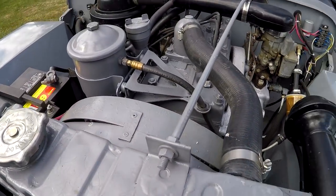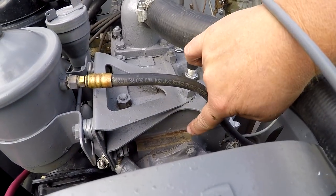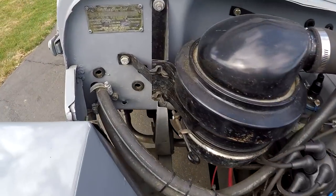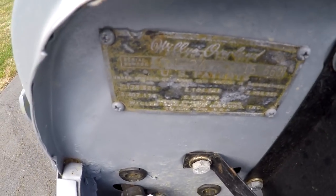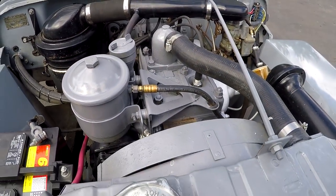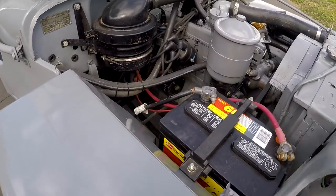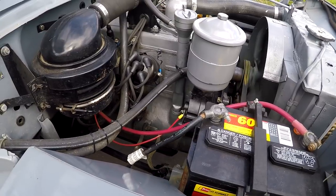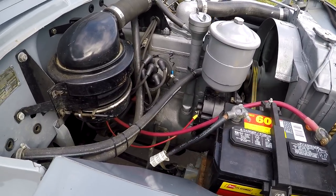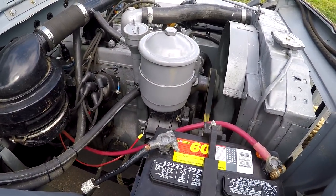The ID number on it is 12234160 right here - that's what it's titled off. The engine number is there, and you can see it's got a Willys tag - number 152660. The title is titled off the engine, which isn't uncommon on a lot of 30s and 40s cars - this is a '48. If this was an actual military engine for an M38, it would have different numbers, but basically the engine would be the same. You'd also see 24 volts usually, but this is running on a regular 12-volt system with an external oil filter.